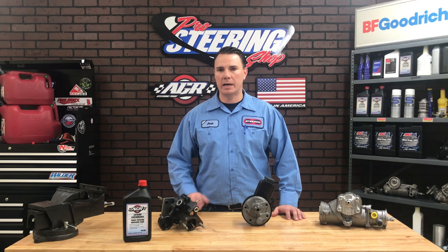I didn't show you every cycle that I had done bleeding the air out of the system, because of course you've got your own power steering system to bleed. But I wanted to let you know that it took me 90 full cycles before I felt confident that I had gotten all the air out of the power steering system. So just be patient, take your time, and ensure you've done a good job.